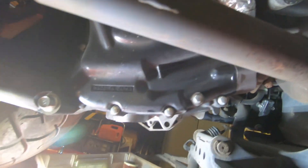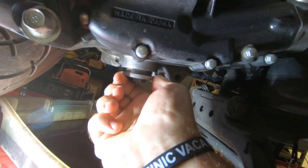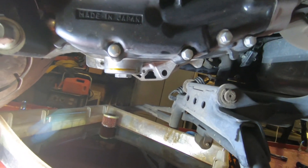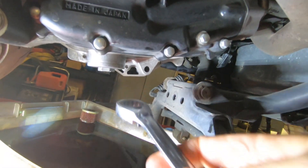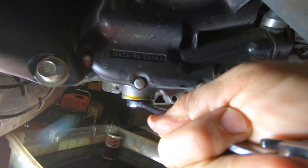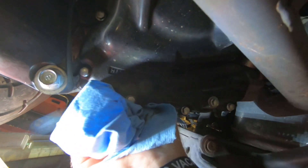Now that I've got the loose dirt and grime cleared away, I'm going to replace the drain cap. Slide it up in here — it's going to have some tension on it, so get it started before you put a wrench on it. Go finger tight first, then slightly snug it up with a wrench. You can see some residual oil seeping out — that's okay, it gets on the seal and makes it easier to come off next time. Take your 19 millimeter wrench and just snug it up. There are torque specs, but I go by feel. What you're doing is seating that o-ring, and that'll prevent any leakage.